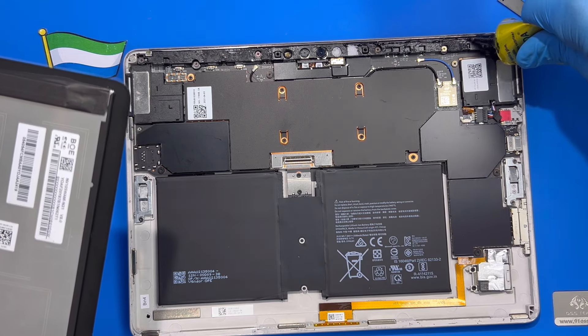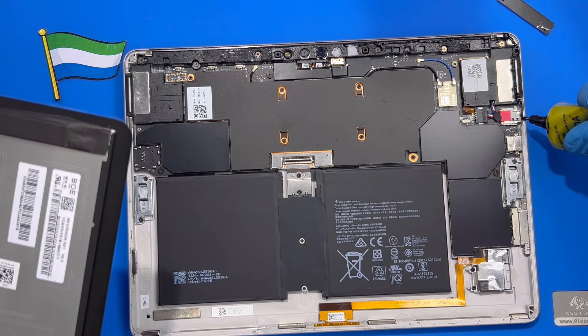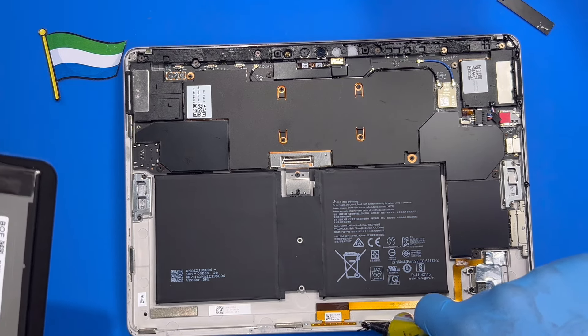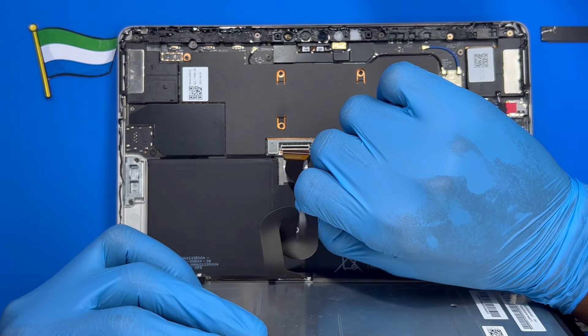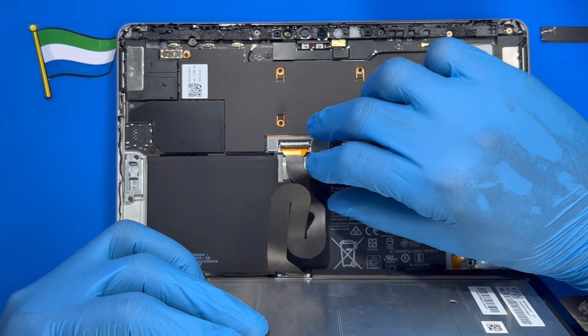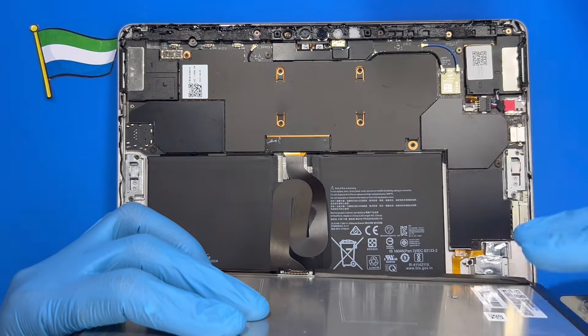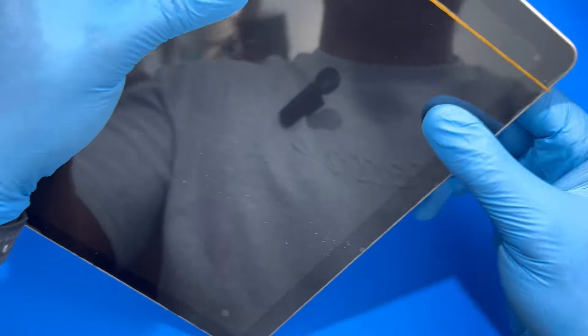Just put the tape right and don't put it on top of the screws. Make sure you put it right on very nicely at the edge. When you come to this side, put it at this side — don't put it on top of the speaker on the other side. Then put it here and make sure you put it right on, very nicely. After applying the adhesive tape, fix the connector — make sure you put it very straight. Then close it and put this panel back also — exactly how you took it, very nicely. Then put this one very straight. If you have a rubber band like this, you can wrap it — that's for 30 minutes so your glue becomes dry. Put it here also — just leave it for 30 minutes so the glue will set before you take it off.